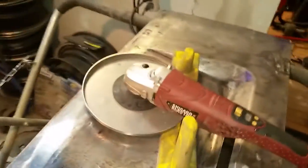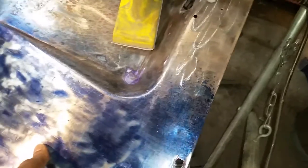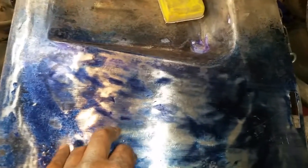This is my deck lid that I'm repairing for my bus. I have a shrinking disc here, and I sprayed some blue steel layout fluid on it, then sanded it down in all directions to find the high spots. I'm applying the shrinking disc on the high spots, letting it heat up, then cooling it down quickly with cold water. The metal basically stretches when exposed to heat, and the quick cooling causes it to drop down a little lower than it was before.